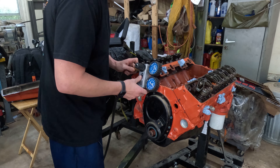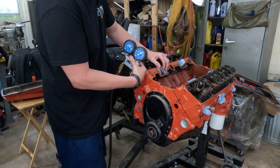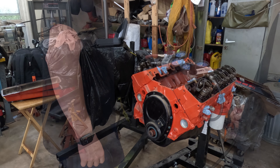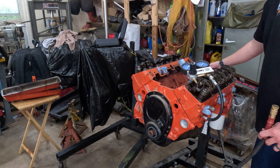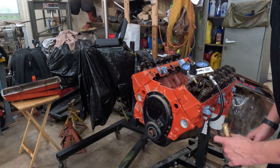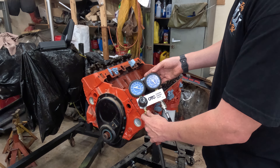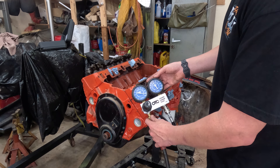So we got 90 coming in. I can hear it leaking past the rings and we're at 70 psi on that one. So let me write this down. Recording on my phone over here: cylinder two was at 72 percent leak down, which for a rebuilt engine - what we assume - isn't bad. If we hold 72 across everything then we won't worry about it.